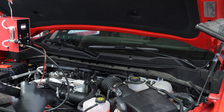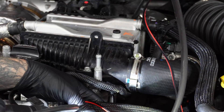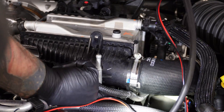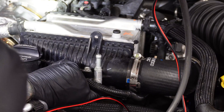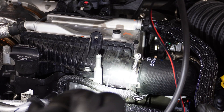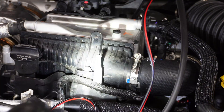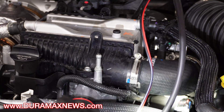I'm going to pull this out and we'll see how much smoke comes out. Pulling it off — see how it was full of smoke, so it's going to come out for a little bit. Basically if you have a leak, that's what it's going to look like right there. Plug that off with your finger and look around — if you see any of that smoke anywhere, you know you've got a leak in that area. We're looking solid right now, happy to say no leaks. Hopefully this was helpful to understand what a smoke test is or to know there is a potential issue with these intake manifolds — they do get a little crack. Check the links below to pick this unit up or read the article on the bulletin. Until next time!